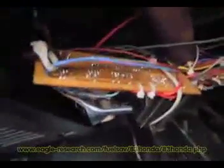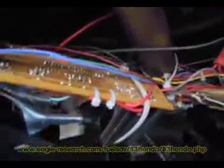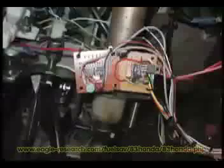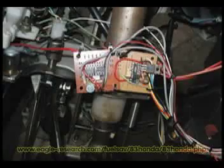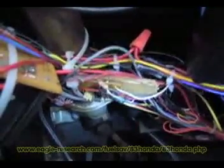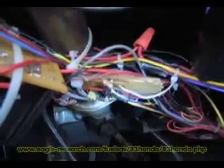That's the hyzor circuit board, which you can look up in the hyzor manual to learn how to build one. This is the original circuit board I built back in the 90s for this car. This is the circuit board for the deceleration fuel shutoff. In this particular case, instead of using the vacuum switch to shut off the fuel, I've gone with the RPM switch.